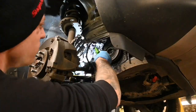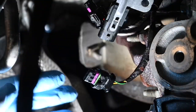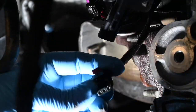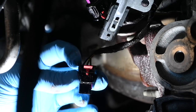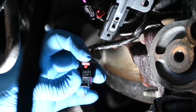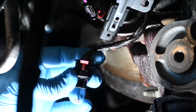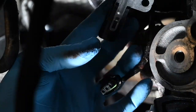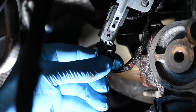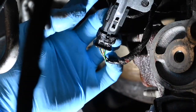Just to show you with these electrical connectors — they are a push fit, so as soon as you push them on you should hear a little click. Most importantly, that red tang at the end needs to be pushed towards the plug to lock it in place — same for both of them. Top one: click and push. Bottom one: push in, there's the click, then push. Both of them are now connected and locked in.